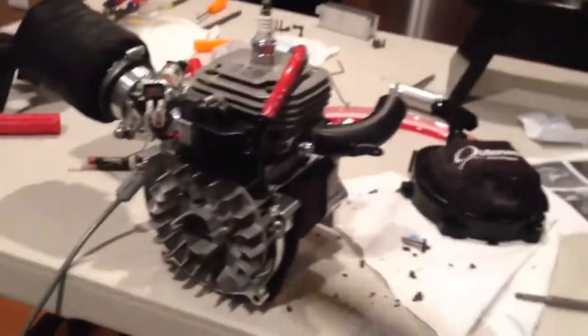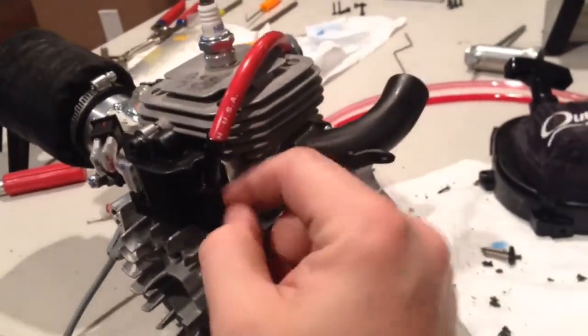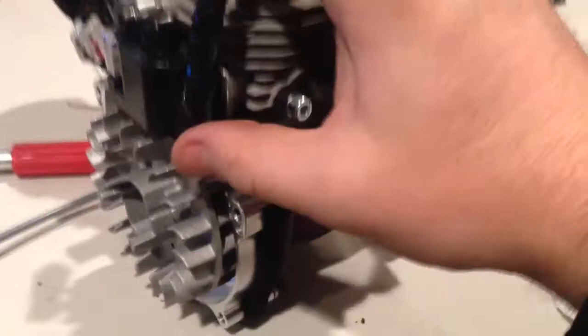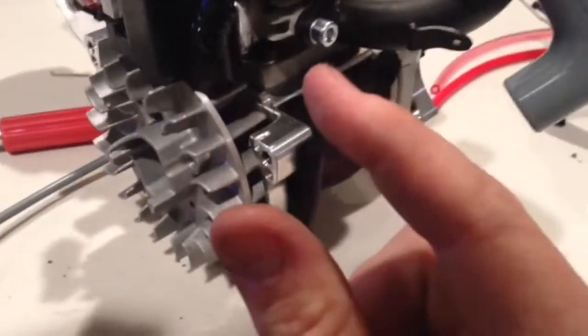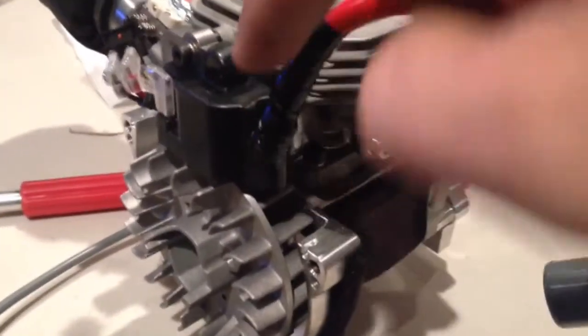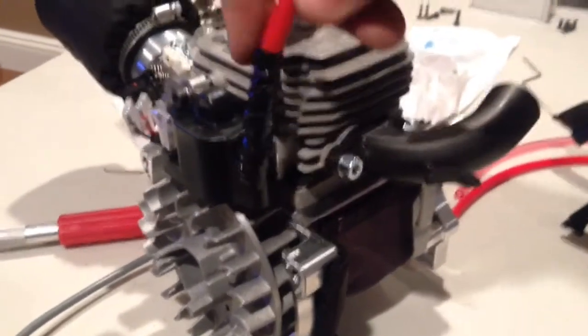That's how we do it. I'll do more of these — the next one should be easier. Another thing I always do after the wire is installed and the heat shrink is on: I add electrical tape, nice and snug. The tough part is getting little pieces — about an inch and a quarter — and sliding them down into the groove behind the coil. I did about three layers in the groove, then went around and around with the electrical tape from there.